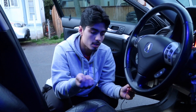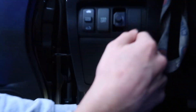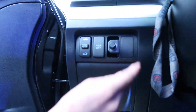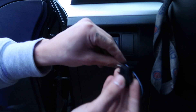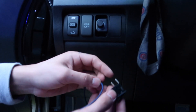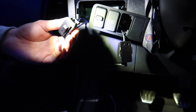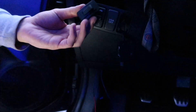I'm going to add a switch to my lights so I don't have to use the remote all the time. I'll just leave my lights on and use the switch to turn them on and off. To add a switch, just make sure you have enough wire to reach it — my switch is going to be right here. Splice into the positive wire and then solder your connections onto the metal brackets coming out from the switch. Now we're just heat shrinking this, and I had to take this panel off to route the wire through.